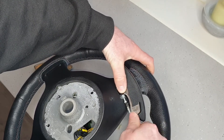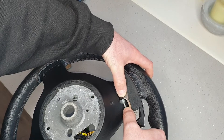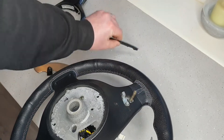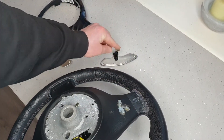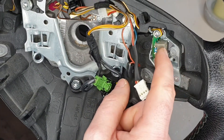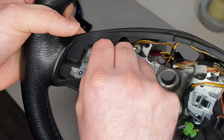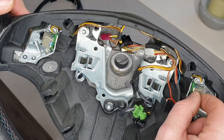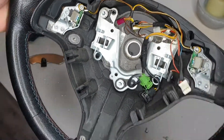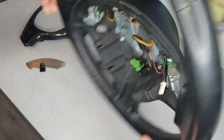I'm going to put my thumb on just to take the tension off the spring. That's stopped undoing so I know it's loose. Put my thumb on and slide it out, release the tension — that will come free. Spring out. What you do need to be careful of is make sure your little micro switch covers aren't broken — some are broken and they can fall out. These ones seem pretty good, they're intact. The cap covers do normally just come off but I'm going to tape those down to make sure they don't get lost. The loom can stay in place — they can strip it, re-trim it, and send it back.